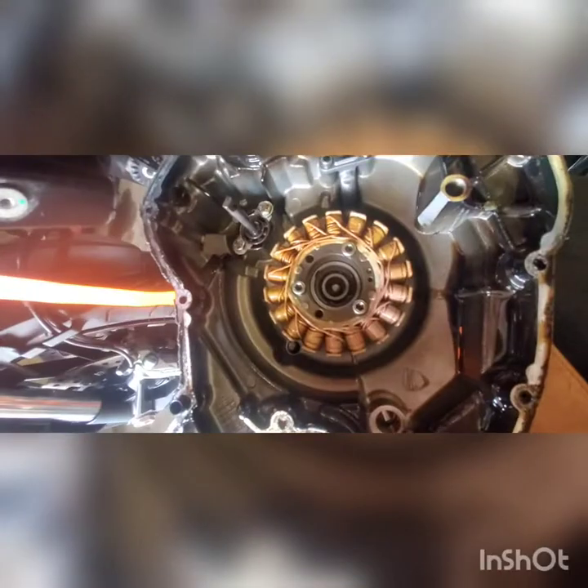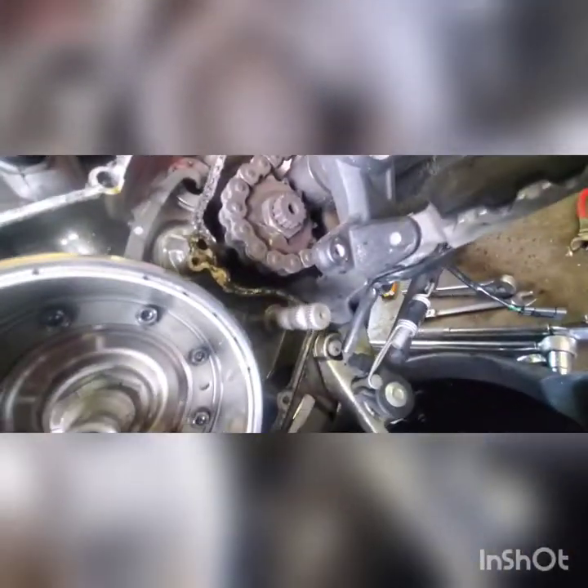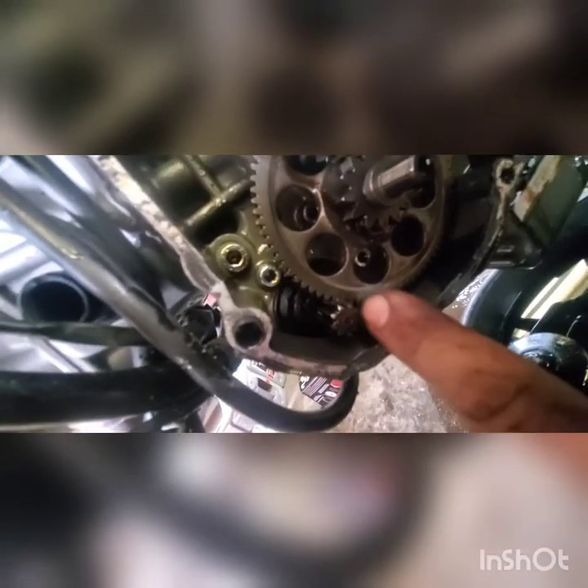Got your stator basket, your stator generator, your water pump shaft, an idler gear, and your shifter shaft. I already replaced the starter as stated before. If you were just doing the starter, there are two bolts there and one on the back side — remove those to slide the starter out. New gasket, loctite on the bolts, torque to spec. I'll put the torque specs in the description. The starter clutch sits behind here. You've got an idler, or intermediate gear. The nut has to come off and you're going to need a puller of some sort, though some people say it slides right off.